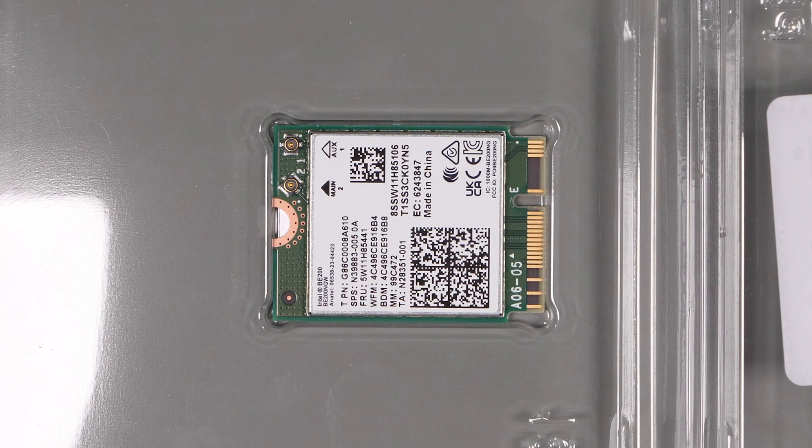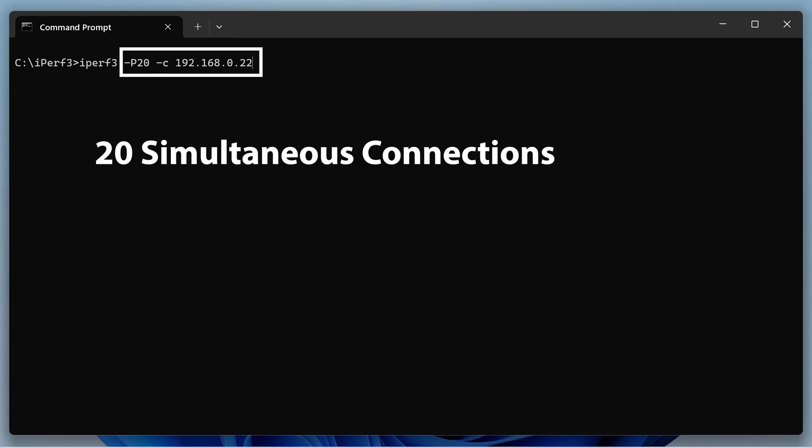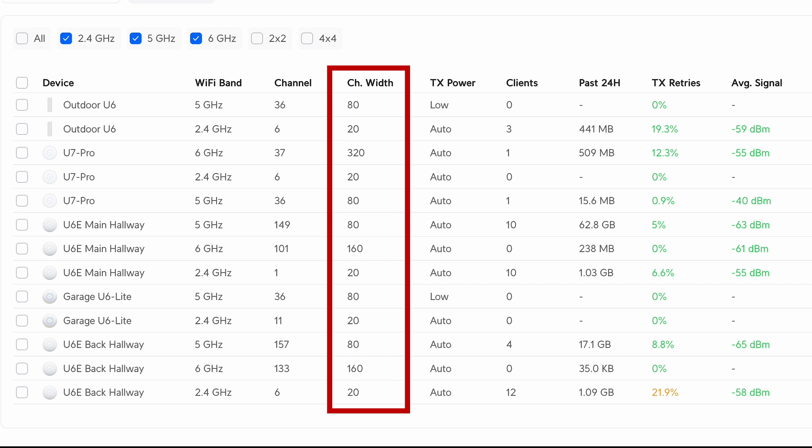With the exception of the OKN, all the other cards have almost identical specs. Now let's run these five cards through iPerf 3 to see if they perform the same or if there's any variation. iPerf 3 is the best way to test networking speeds because it lets you push capacity using multi-streams, which is now a big feature of Wi-Fi 7. There's a lot of variation in Wi-Fi based on environment, distance, interference, and settings — these are my channel width settings used as a baseline, which I found work best for me and kept consistent throughout all the testing.